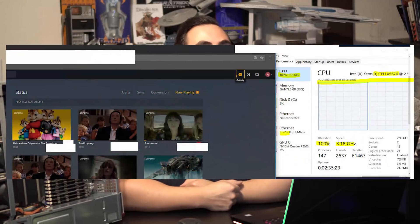The first test was H.265 1080p to H.264 1080p. Plex playback quality was set on maximum. I compared the results of the dual X5670 CPUs with the P2000, and I also threw in some tests with the 6700K with Quick Sync enabled and a 980 Ti, so I could compare the performance of a more powerful gaming GPU to the Quadro. The dual X5670 with hardware transcoding off played a total of 5 transcodes. Depending on the media used, whether I needed to transcode AC3 to AAC audio, I might be able to leave a 6th transcode running.